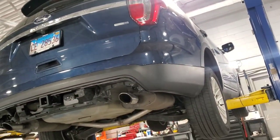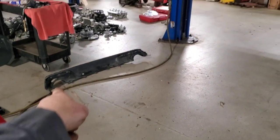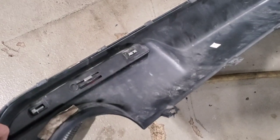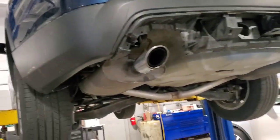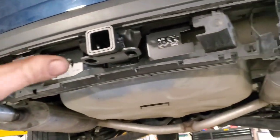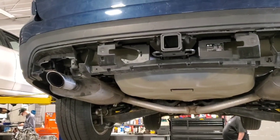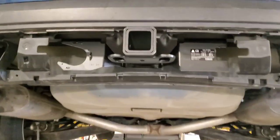Here I got everything back together, everything's bolted back up. I pulled out that plastic center section - it's a pain because you've got to come behind here and all those clips have slots that they clip right into. You can see that open clip right here where my hand's at, and you've got to bend and pry open certain areas to get them out, pop them out of there - once you get them out it just basically folds right off. I went back through and put everything back the way it goes, put the lights and everything back in. I ordered this center section to actually fit the trailer hitch that comes specified with trailer brake vehicles from the factory. This is your Class 3 hitch install on the Explorers.